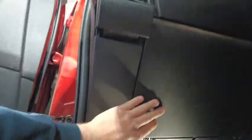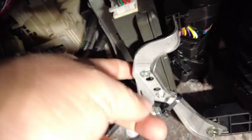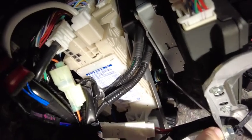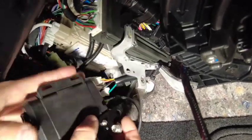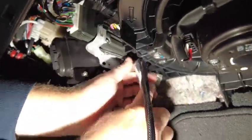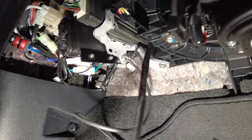On the passenger side, below the glove box, there's a tab mounting an ECU. This particular vehicle has a second ECU with a bolt and a welded nut. We're going to position and sandwich our mounting bracket between these two steel surfaces. If your vehicle doesn't have that bolt, that's where you can use our supplied nut plate and 6mm metric fastener. I've lifted this into a position where it's parallel and then tightened it up.